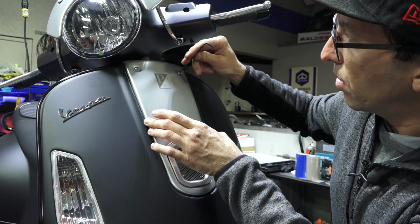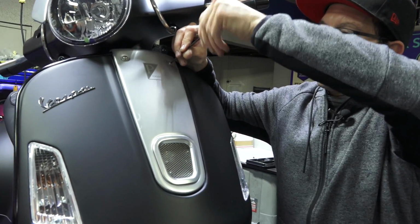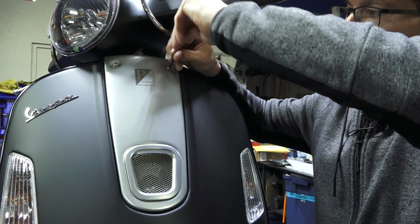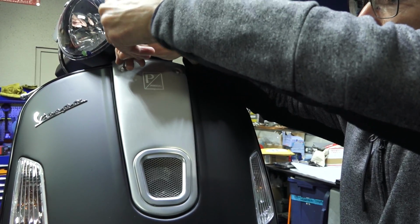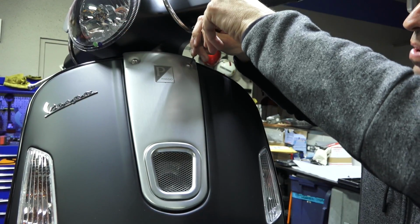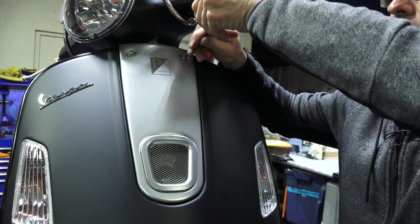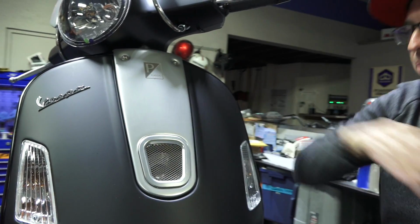With well nuts, you don't want to crank them down too much because they are rubber. You just want it enough where it holds the part in place. They kind of spin a lot with some resistance. The well nut is pretty much a brass insert inside a rubber grommet, essentially. They're very common on windshields on motorcycles, so that part's all installed.